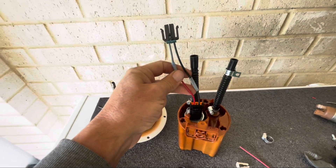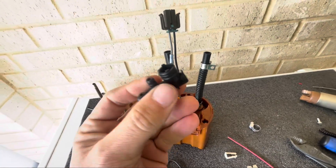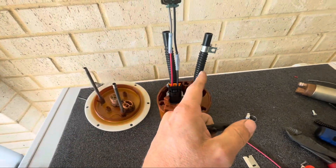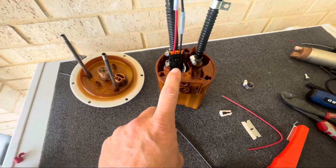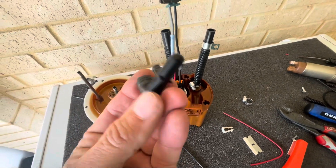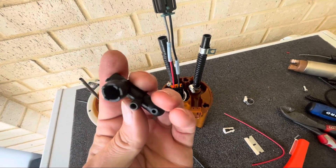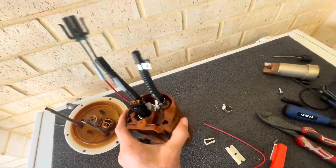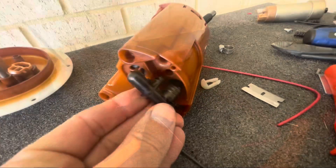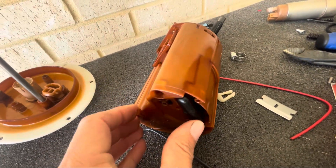Just connected that cable — black to black, red to gray. Now I'll quickly show you what I think they call the venturi: this little hole on the end here feeds the return line. If you have a more demanding fuel system and a higher flowing pump like a 460 or 525, you would drill that out, but since this is naturally aspirated this should be fine and I don't have to touch it. I just popped it out of the bottom to have a look — I'll just clip that back in. It literally just clips into the bottom section with little barbs.